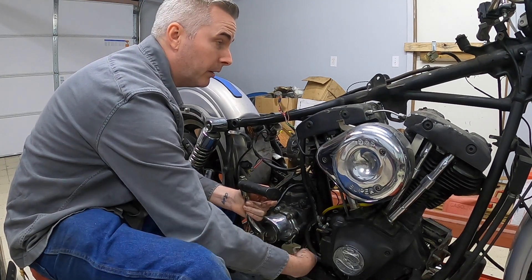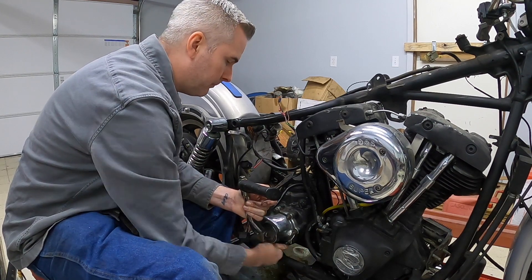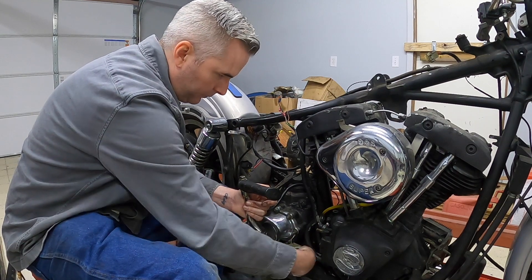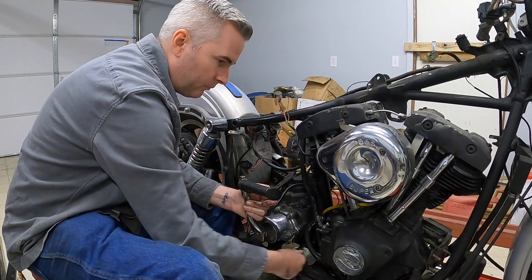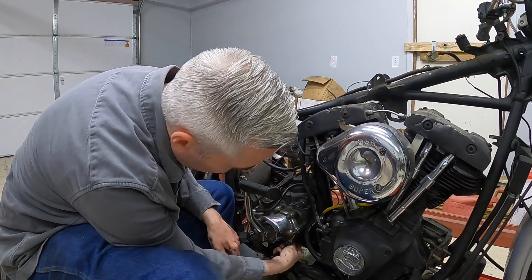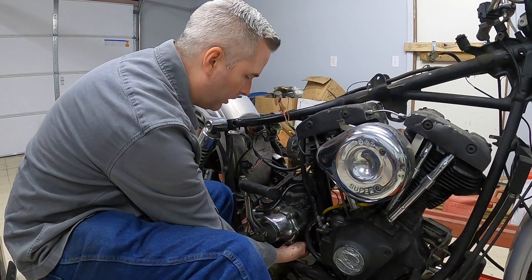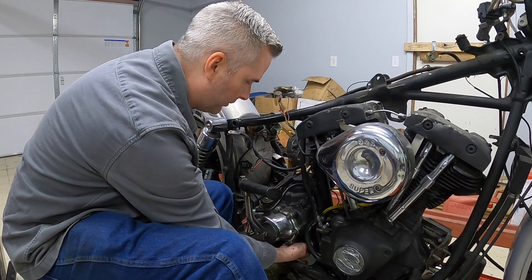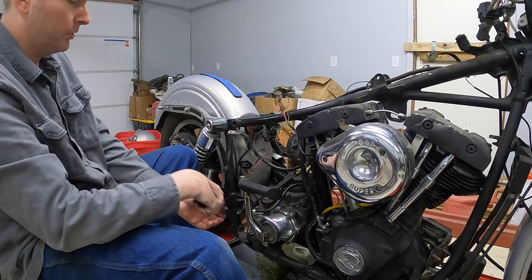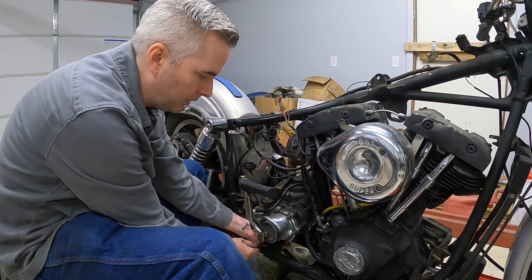It's quite a long-winded stud there. Looking at this, I may need to come back with a frame jack in order to take the suspension off the rear of this bike to pull the swing arm in order to get the transmission out. Not sure if there's just enough room or not quite enough room - I guess we'll find out soon enough.